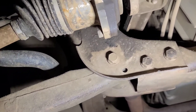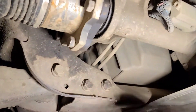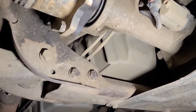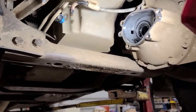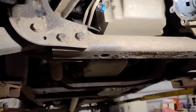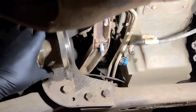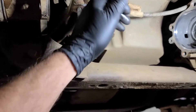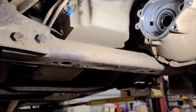This axle flange is pulled out - that's why it's disengaged. We're going to have to take this skid plate off and have a look inside here. You can weasel the axle housing out of there by just undoing the CV shaft on the flange and undoing these two bolts on the mount.